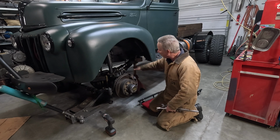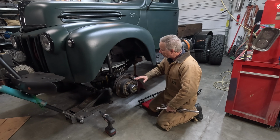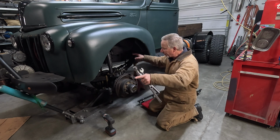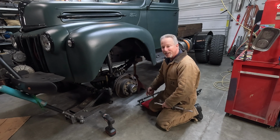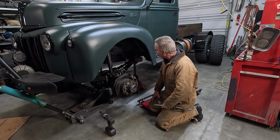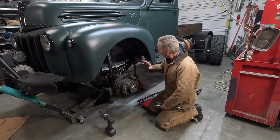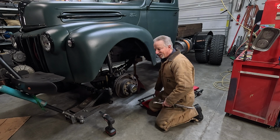But I don't know at what point this spring is relaxed. So I may have to up and down the front end here a bit so this spring shackle is not under tension. I want it fully relaxed in its normal arch, but not so much that it's pulling on this shackle. So wish me luck in getting it out without getting hurt and without having to undo the front one and take the front end axle off, the leaf springs and all of that. Hopefully just the shackle, and then we'll see how it sits once it's 1 inch longer.